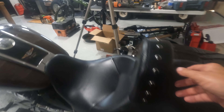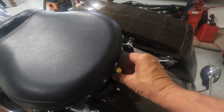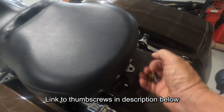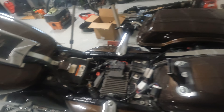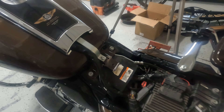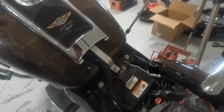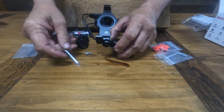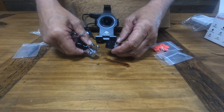The first thing I'm going to do is remove the seat, because I am using the battery adapter that has the inline fuse and wiring it directly to the battery. I've got a thumb screw installed on my bike so it makes it easier to remove the seat — I have another video where I purchased that thumb screw, so check it out. Now I'm going to remove the two bolts that hold the bottom of the gas tank, then remove the screws from the clamp and get this ready to mount to the handlebars.